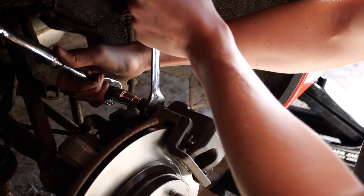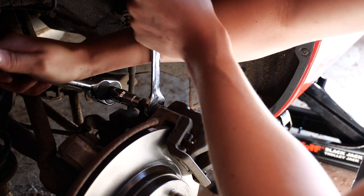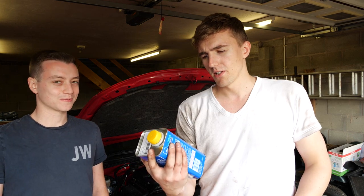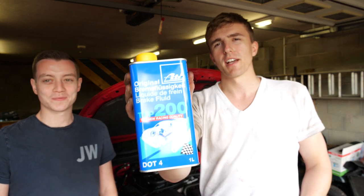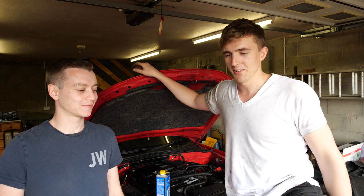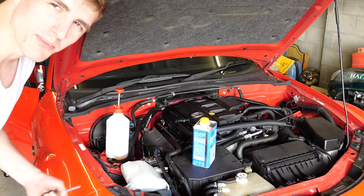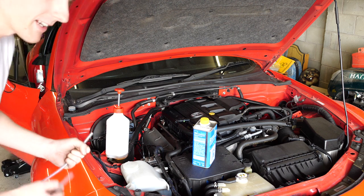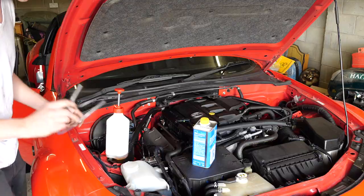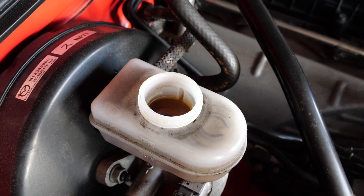Caliper slider bolts back in — about 20 to 25 Newton-metres. Helping me is track-day assistant Dave, who's also coming on track next week so you'll see more of Dave in future videos. Now for the brake fluid flush — using ATE Type 200, which has a boiling point of 280°C so it's a performance brake fluid. Dave is going to be pressing the brake pedal. The car's almost at its 50,000-mile birthday — 49,601 miles. Removing all the old fluid from the reservoir; you can see the colour is almost black, which shows it hasn't been changed in a very long time.